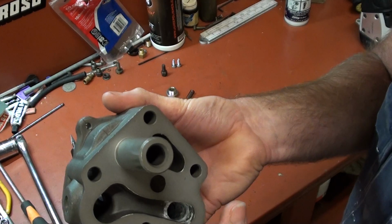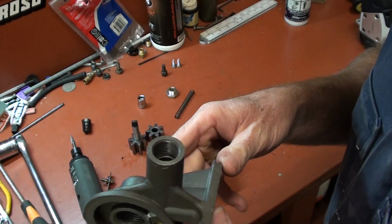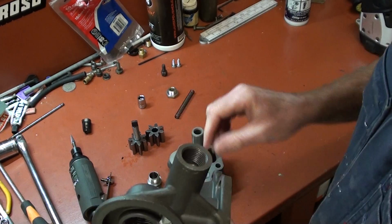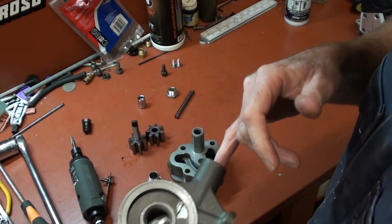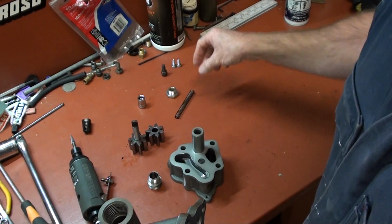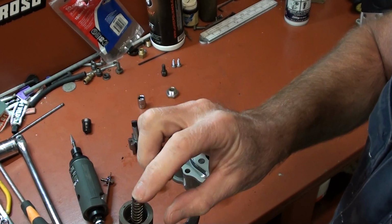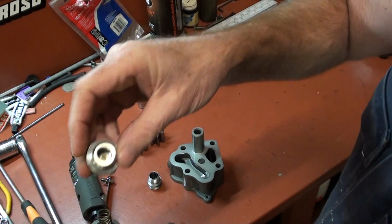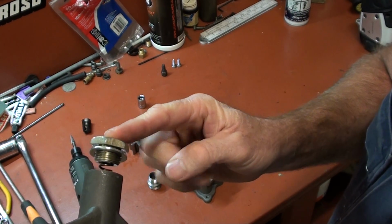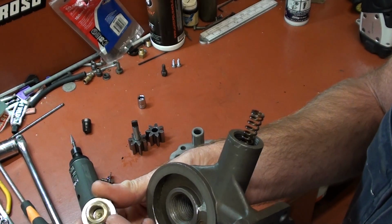Now the last little trick he does is to lift oil pressure overall. This is the relief spring setup. There's a little piston inside which is still in there. I'm not sure if I can even get it out. No, it's still in there. But anyway, there's a little piston in there, and that sits on the spring, and that's the little bung that screws in. And what he does is he machines up a little packer.